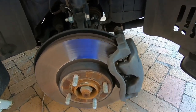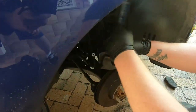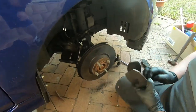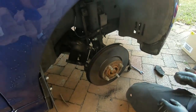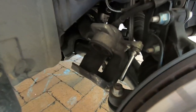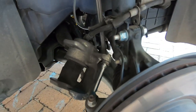Our car's nearly three years old and I'm not sure if it's been done before. I don't think it's been done in services by Ford, so we'll get it done. That tool is awesome. And that's one caliper pushback. Those sliders look good too — they're not rusty, they're still nice and clean, but we'll still lube them up before we put them back in.